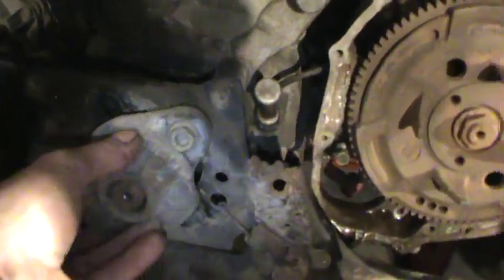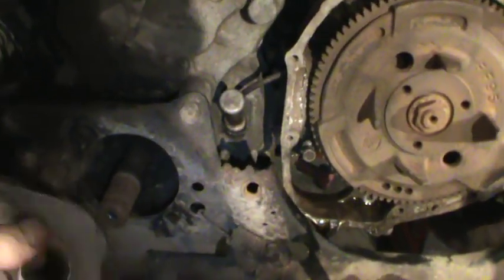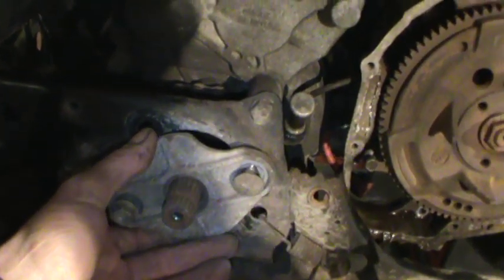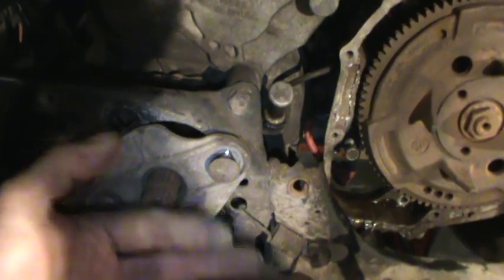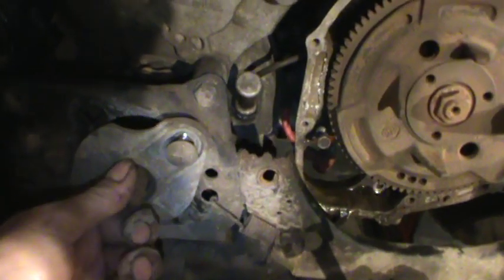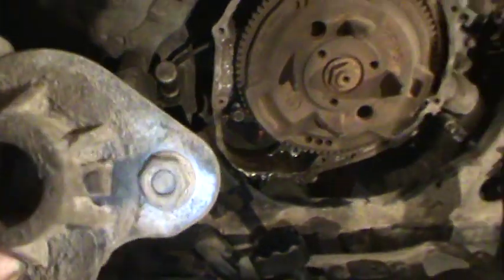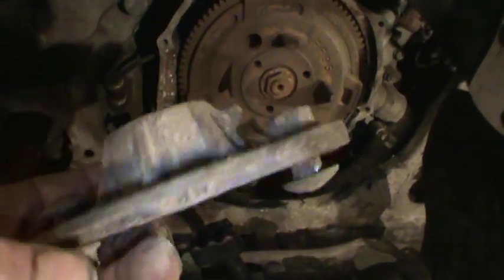On that same shaft, in the middle, is I guess you call it a jack shaft support. Actually backwards. It goes like that. And when I was kind of playing around with it, I could see that I could take the whole shaft, and this is coming right out of the tranny, and rock it back and forth. And there's a sprocket here going to the front, along with the front brake sits here. So this was moving back and forth pretty bad. And I thought it would have had a bearing in there, but it doesn't. All there is, is what's left of a brass bushing.